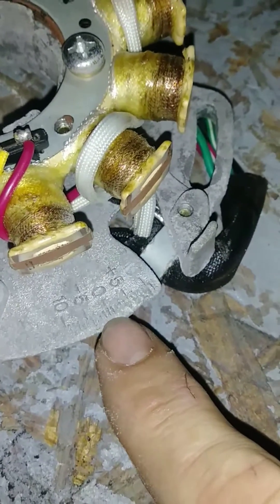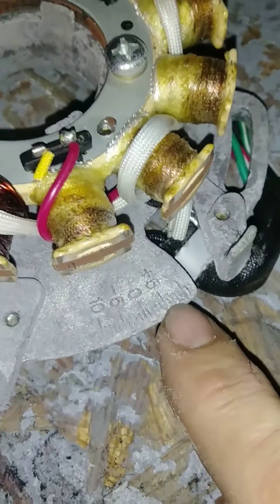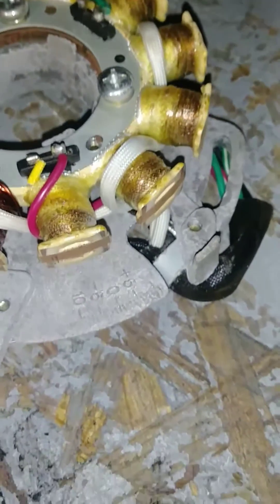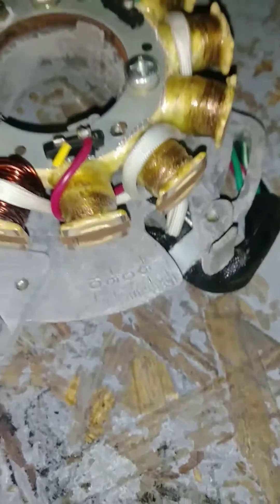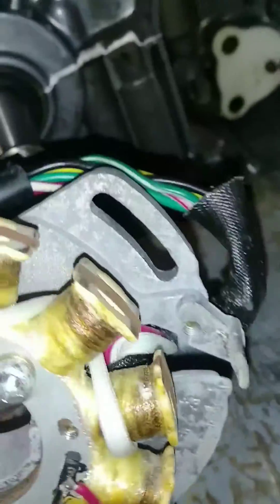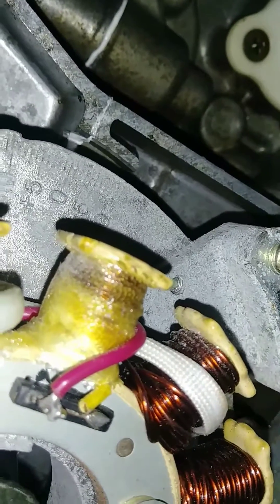With a stock stroke and stock crank, you don't really want to go more than plus four or plus five timing unless you're running high compression. If you're running higher octane race fuel, you can advance it more, because higher octane fuel burns slower.